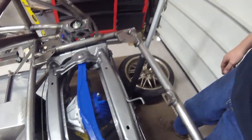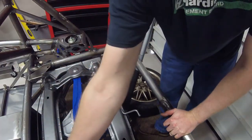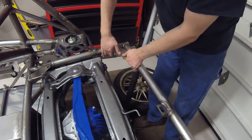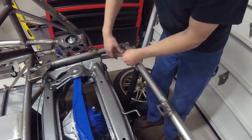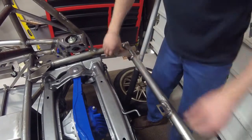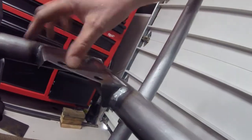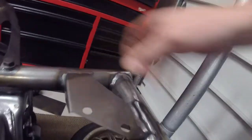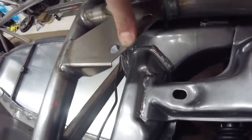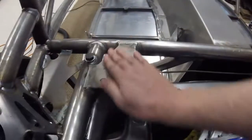There are basically four mounting points for the fuel tank. With these larger ones, just 20 to 30 pounds of pressure you can easily bend these mounts. Let me pick the camera up so you can see just how thin the sheet metal is on this bracket. It's supported with a bend at the end and welded in, and closer to the ends it does stay pretty stiff, however some of these mounting points you can see that deflection — this one is actually already bent from the factory.